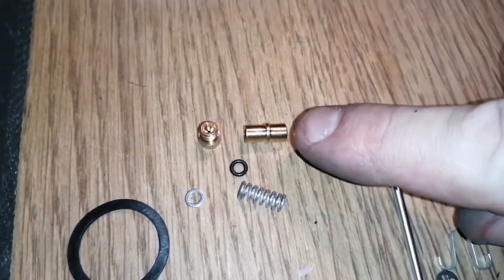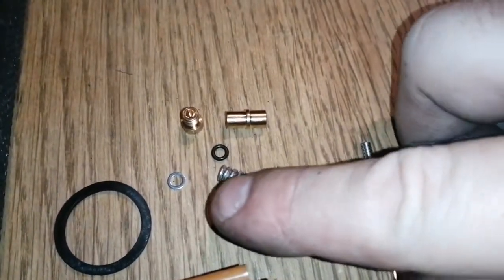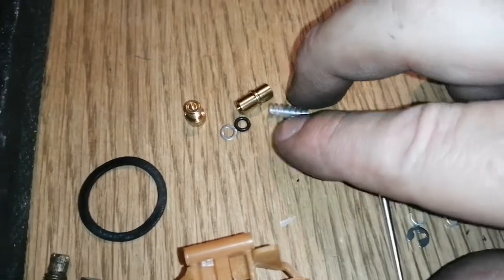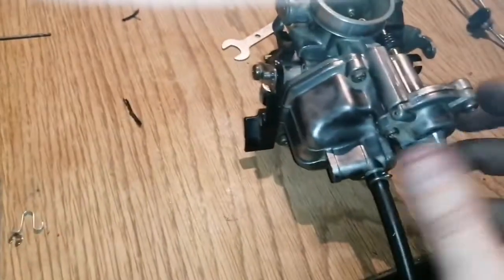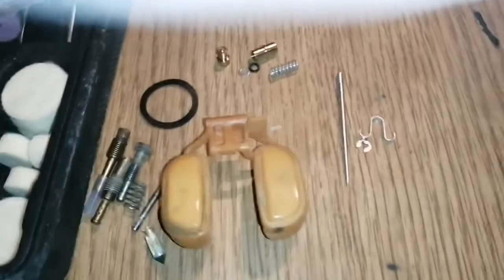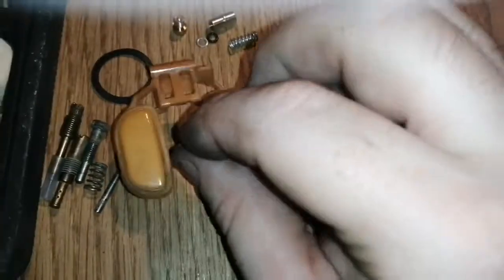I know this piece goes down in the center of it for the needle, but I don't feel I need to go to the trouble of taking that out, so I'm just leaving it. I don't know what this little washer is for. That was the main jet that I didn't put in. This spring kind of confused me as to where it goes because I didn't see a spot on this carburetor - this carburetor is just ever so slightly different from the kit that was given to me, but it's the closest I could get. As you can see it's an accelerator pump carb as well. It's good and clean now, and my only worry is that when I go to put the petrol in, the needle is going to stick or not close - that's why I'm keeping this float and needle, even though the needle's looking in rough shape. That's all I can do for now.